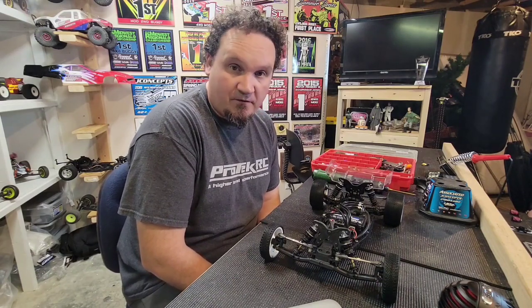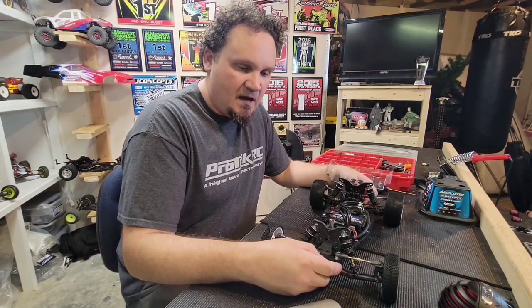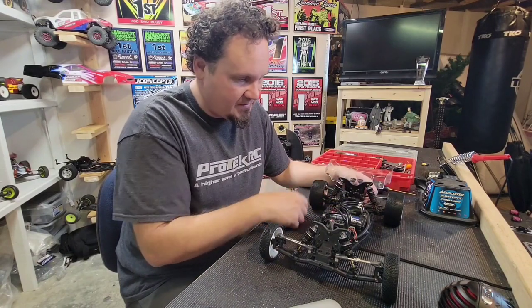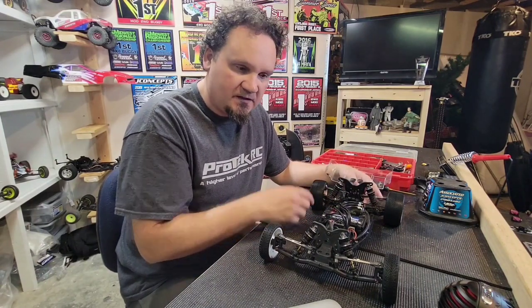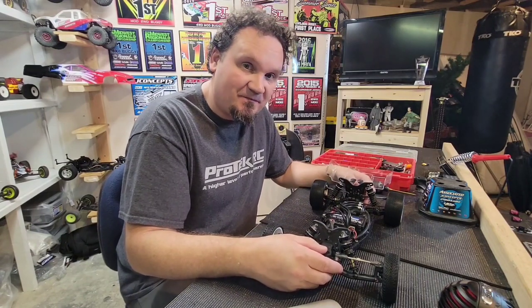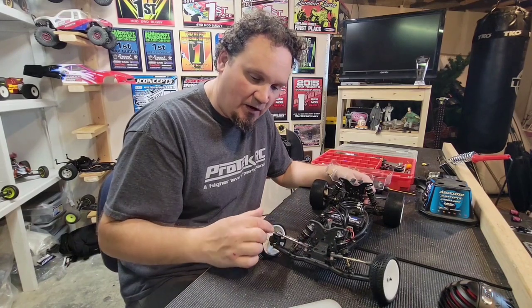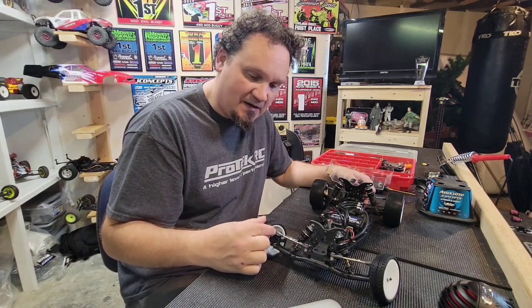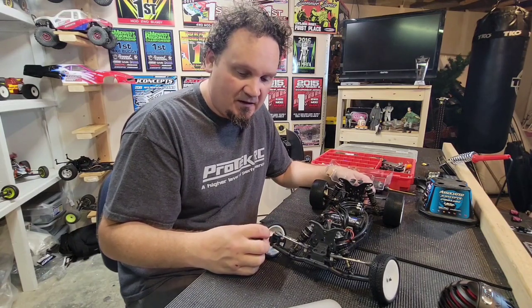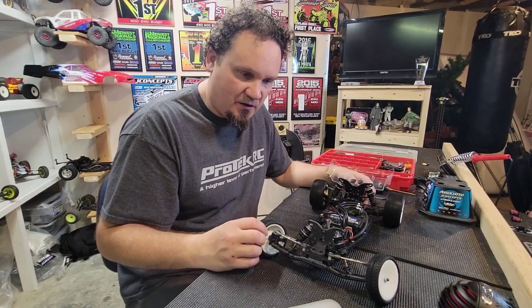The setup's a little soft for carpet, just in my opinion, out of the gate, but I made some adjustments throughout the day. Moved my shocks in on the arm and the tower. I shortened the rear link to try to keep the car from rolling so much, and I was actually leading the main about halfway through, and then I had a female ball stud come off, and I guess I didn't use enough thread lock. Not sure why we used female ball studs instead of just a regular ball stud there, but